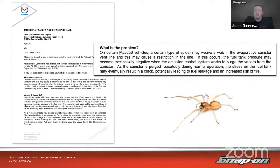Now let's talk about the canister itself. It's a canister — not all that fancy — its whole purpose is to collect EVAP vapors, with activated charcoal inside to absorb them. However, nowadays it may also contain electrical components. Here's an example on a Ford: there's a two-wire electrical connector that comes with the bracket, and what they call a 'vent filter' is actually the vent valve on this vehicle. If this vent valve fails, you have to replace the entire canister, because it's not available separately in the aftermarket. So just a vent valve replacement can get pricey.